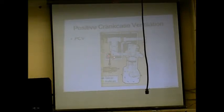That valve was designed to open and close depending on engine operating conditions. There are certain conditions where you do not want crankcase gases getting into the intake. At idle, you don't want any gases getting in, because there is so little air and fuel mixture. The slightest bit of impure gases getting in is going to cause a serious issue with your idle. So the PCV valve will be closed at idle. You also want it to be somewhat minimized at wide-open throttle.